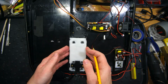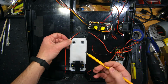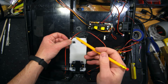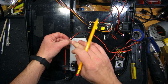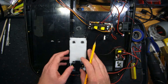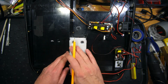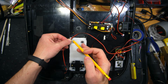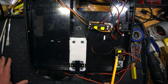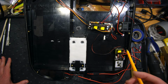It is absolutely the same story on the other side of the inner shell where the controller board is located. The only difference is that we have an extra hole for the cable coming to the speakers on this side of the reinforcement plastic. This is done because the side cover will tightly fit this melted plastic here without any gap. And the main reason for putting the cable here is that the Bluetooth music board is now located here. It is also installed here with the thread bushings melted inside the inner shell.